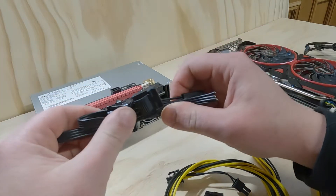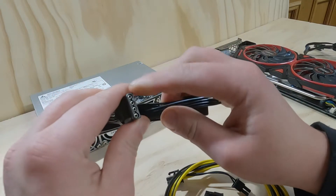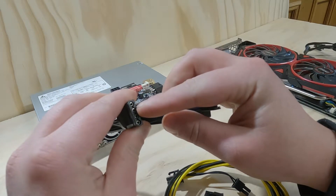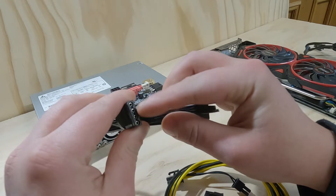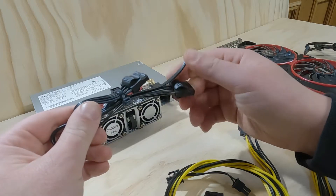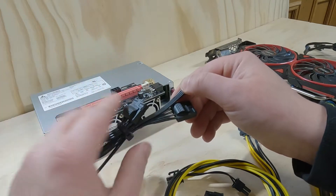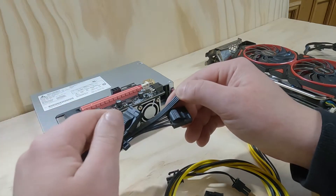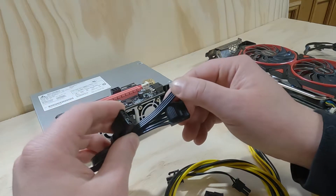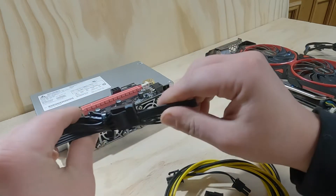That's all I want to say about the Molex cable. Yes, it can run 156 watts, but there's no standard for these pins — you can't pick what rating these pins actually have. Now they could be at 156 watts, but usually when you've got one of these cables with a few connectors on it, if you have like three hard drives or three case fans, this is more than capable because you're not going to go over 156 watts across three different Molex connectors on the one cable.